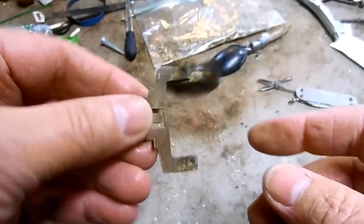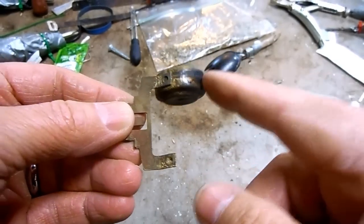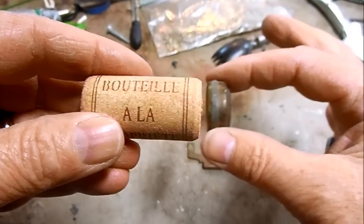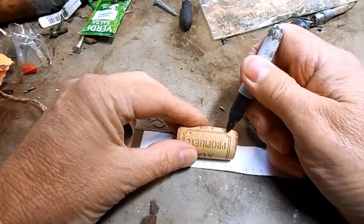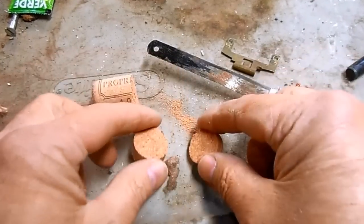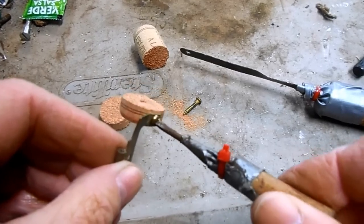For Brody's broken float, I'm not going to just replace the second float on the side that's missing — I'm going to remove the old float and install a brand new set of floats. Always recycle your old brass parts. I need to cut this float material down to the correct width of the stock float — that's 15 millimeters, and I need two that are exactly 15 millimeters. I always use pure brass float screws, and make sure you don't over-tighten them.